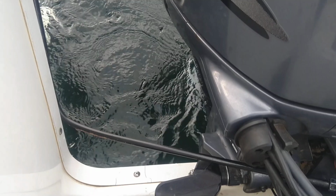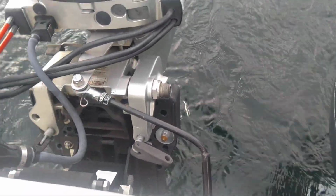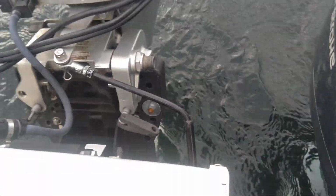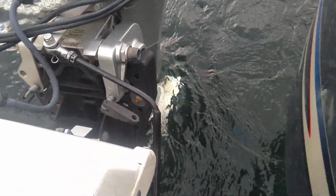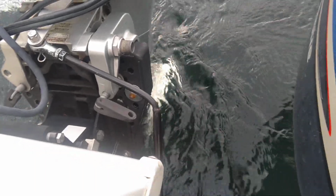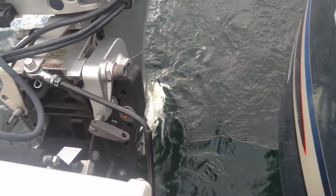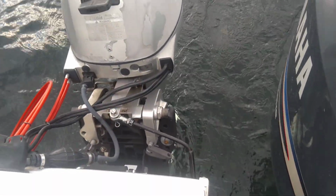the bar comes up. I've got one bend, two bends in there. Now, here's the tricky part. There's a third rotational angle that I could not get, so I cheated. I took the 3/8 bar and a 1/2-inch OD tube. Everything's from Lowe's, and I cut it and I used a slip fit. Once I got my angle correct, I welded the two ends, and I've got the two ends.